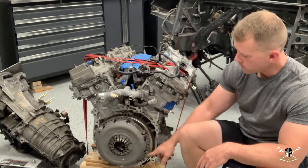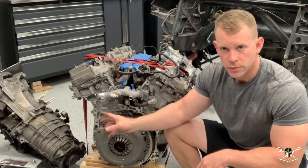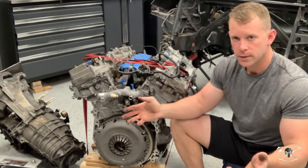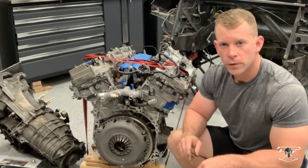There are no provisions anywhere on here to mount a starter — this engine side does not have any place for a starter, and the Porsche transaxle does not have a place for a starter either. So we're going to have to figure that out, and we're also going to have to make our own adapter plate. First order of business: we're going to come up with a method of getting a starter attached to this.